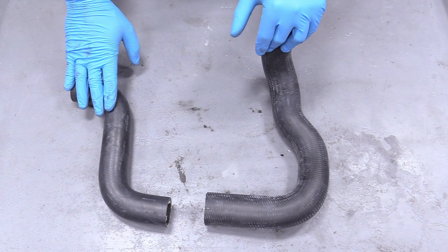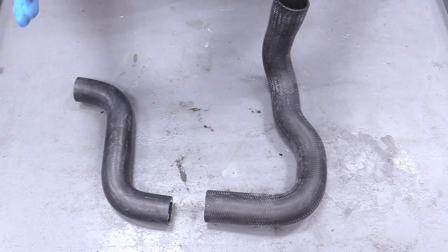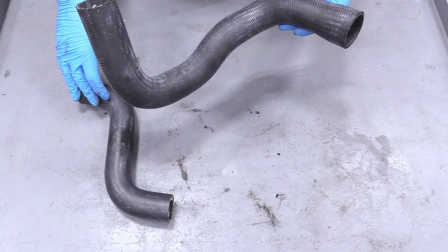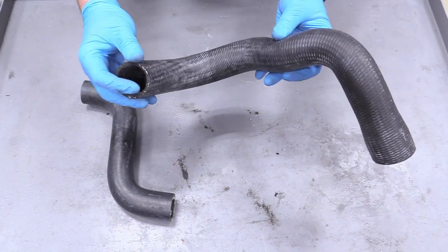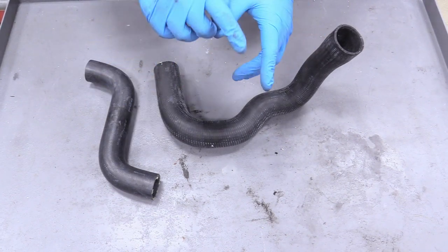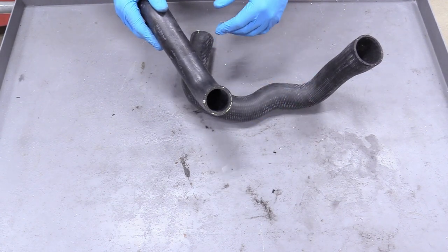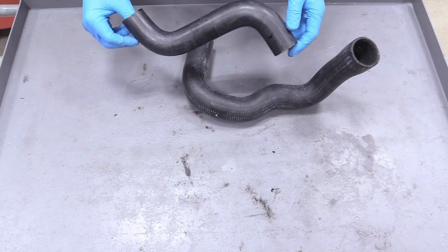Now let's talk upper and lower radiator hoses — this is honestly where some people get lost because there are a couple of different ways to go about it. You could get really flexible hose and run it in there if you have room for nice gradual turns, but we don't have that luxury. I went to my local auto parts store, went in the back, and found some hoses — who knows what they go to. The things you need to measure are your total distance, the shape it needs to be in, and the diameters of your tubes. I believe this one is an inch and three-quarters, and this one is about an inch and three-eighths. They can be a little off because the hose clamp will close it down — you can go maybe a quarter inch either way and probably be fine.